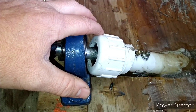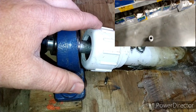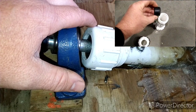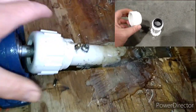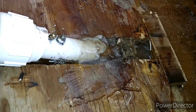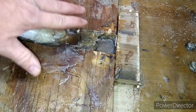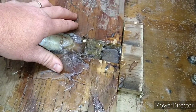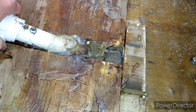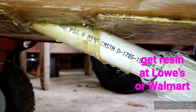Alright, this glueless union coupler — whatever you want to call it — I went to Lowe's and took a video for y'all. It's got a rubber gasket in there and it all tightens down, and that's pretty much what this is doing. Now, I cut a substantial hole in the boat. But once I got my pipe in there into the strut on the bottom and everything was like I liked it, I used a substantial amount of fiberglass and resin to seal up my hole. You'll see where I even put this block on the back to hold that. This is very, very thick in resin and that stuff is fantastic. Let's go around the bottom side of the boat. You see where that resin has run down? Doesn't really matter as long as it's sealing holes. You see the little pieces of plywood that I put to help seal my substantial hole — a lot of fiberglass and a lot of resin.